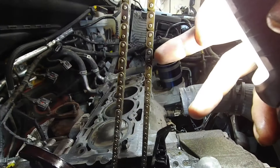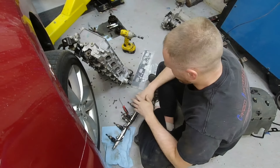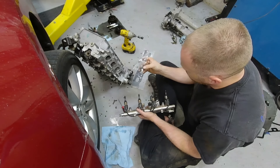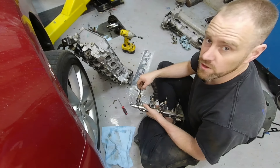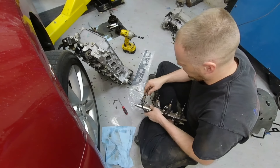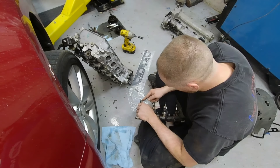Right here is one of those darker links — much easier to see. I believe I have it in the right position. Now I'm going to get the parts back on the cylinder head. The gasket set came with new seals for the injectors, so I'm going to put the seals on. When doing these, they can definitely be a bit tricky, and you want to do this a decent amount of time before you put them in the head — I'll explain that in a second. First, I'm going to use a pick and very carefully remove the old seals.